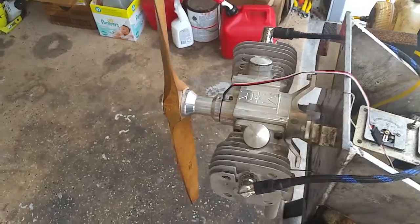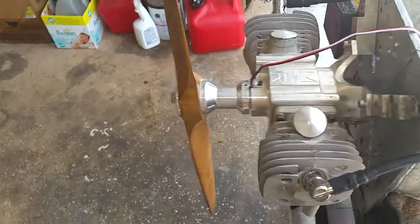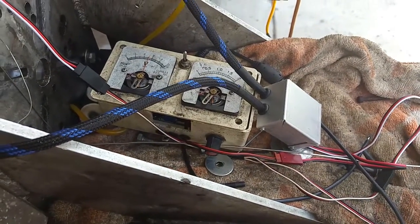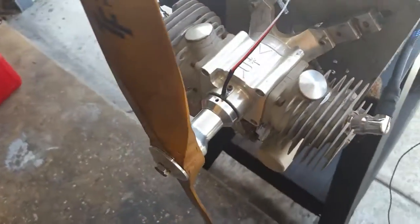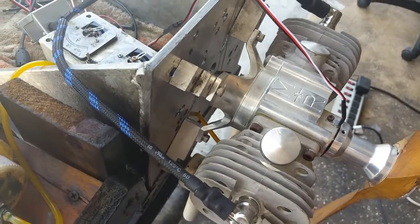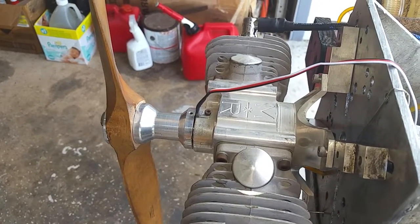This is the MNR 100cc - I think it's the equivalent of the BME 110. Sensor: engine timed 30 degrees before top dead center. CDI: that's the new unit I'm making now. I make all the twins in aluminum boxes now - I finally got a pretty good deal with the supplier. California decided to give me a better price on those so I can afford it. Prop: 2410. Idle from what I see is 1,200-1,300 to 7,000-7,100 RPM.